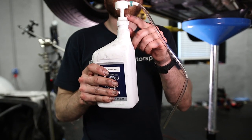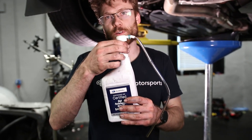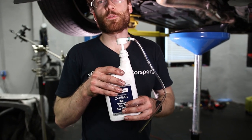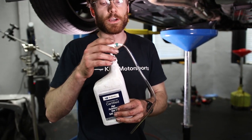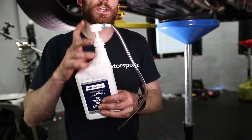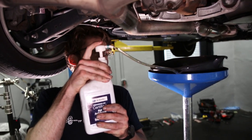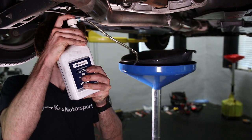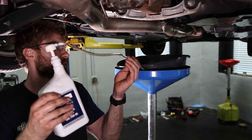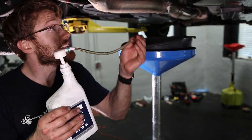You're gonna need a pump like this one. This is a really nice one because it actually screws right onto the top of the bottle — I'll have a link to this pump or a similar one in the description. I have used this pump for other fluids, so ideally you should get one pump for each type of fluid to avoid cross-contamination. Just to be safe, I'm gonna squirt a little bit of new gear lube through here to remove any potential cross-contamination. Be careful using anything that would actually clean it, because something like a degreaser could stay in the line and contaminate the oil going into your differential.